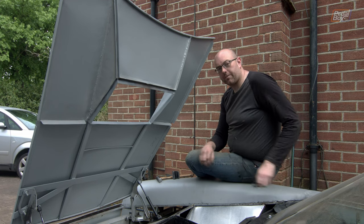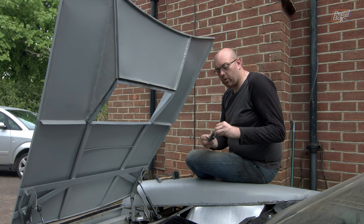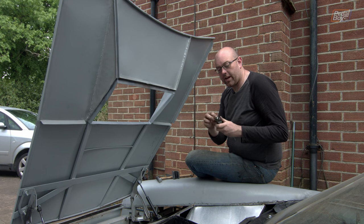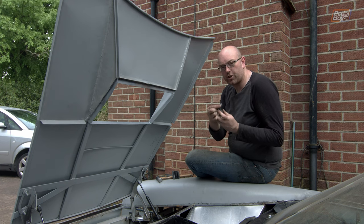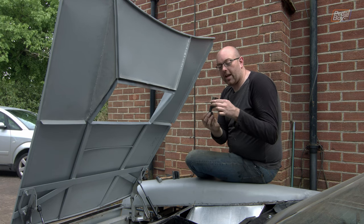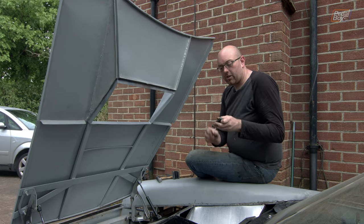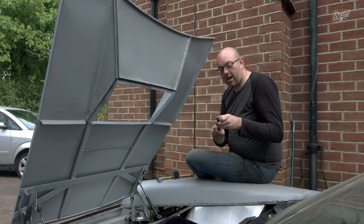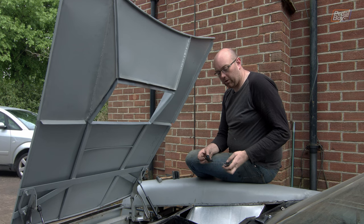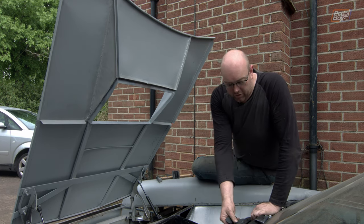Before I get onto the bonnet I'm going to address something we didn't finish last time because we didn't have the parts — our new drop links. We have these to work out the alignment, but the only thing that needs replacing is this bushing on the bottom. It's really two M10 nuts just welded together on the end of the rod. We need that able to pivot so that it can follow the ARB when the ARB rotates up and down. So we now have the M10 heim joints that we can put on the end of these. I'm also going to look at washer jets and how we can mount a pair of these on the front of the screen here.